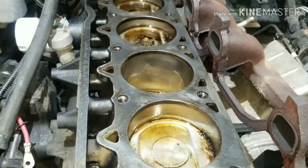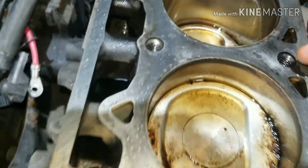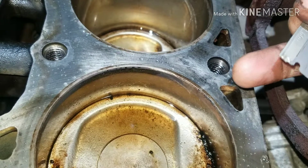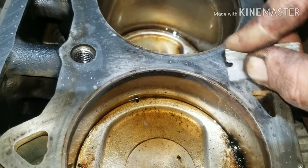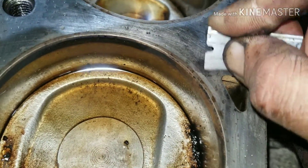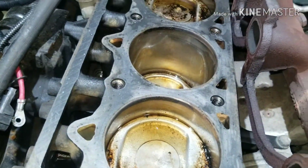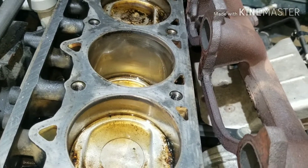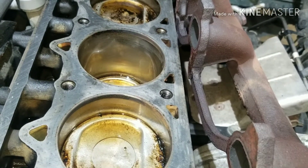You can see it's super cleanish but you've got this black spot — see that where my finger is? I sprayed this with Carb Spray and that wasn't visible until I sprayed it. So you can take a razor blade and start working that stuff off. Just keep at it and get all these black spots off, because even a little bit of abrasion or something that sticks up can cause your head gasket to fail. After doing this big job, you don't want that to happen, so take the precautions now to make sure you never have to do this again.